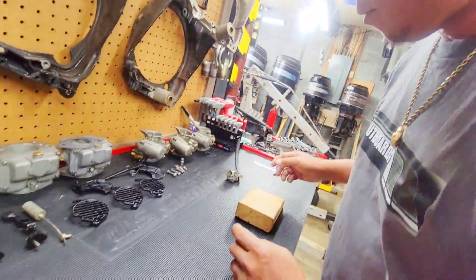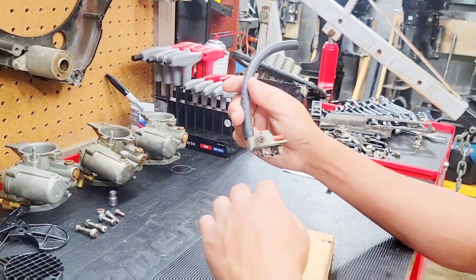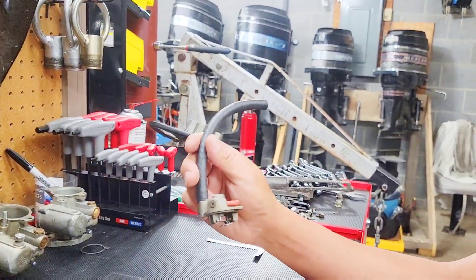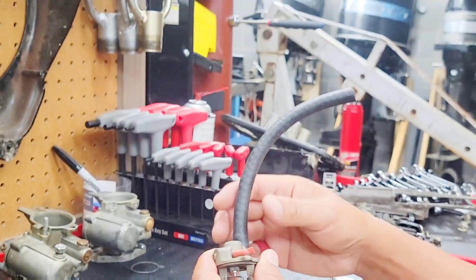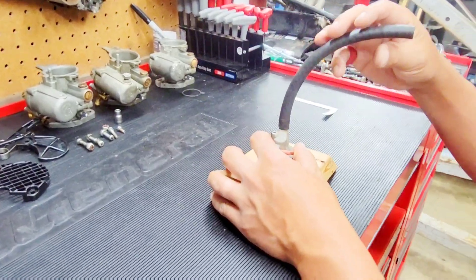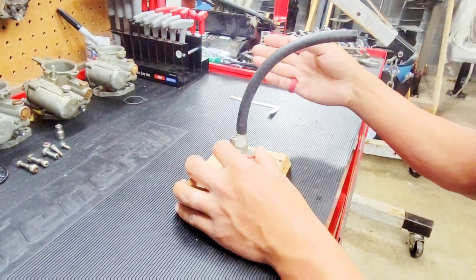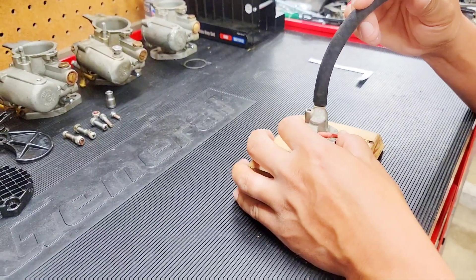I'm going to show you how to properly set these tangs. So the tangs drop — you can see, there's probably a measurement there, like a quarter of an inch or something. What I did was just connect a tube here so I'm going to blow air. Because if air can get through, fuel can get through, which is called flooding in your carbs. So what you want to do is just set this on a flat surface like that. When you blow in here, nothing should pass. So nothing can pass.